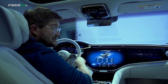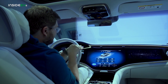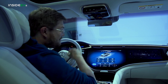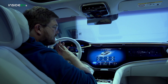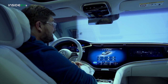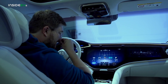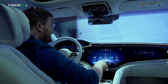This car has two different options of rear steering. The first is 4.5 degrees of rear angle — that's standard. Then you can opt for a 10 degree rear angle steering, which matches the Hummer EV. I love cars with rear steering — it gives a long wheelbase vehicle a magical short wheelbase feel around town. You also get comfort door settings, you can lower the rear headrests just like every other Mercedes, and so much more to go into.